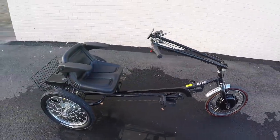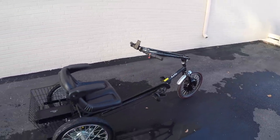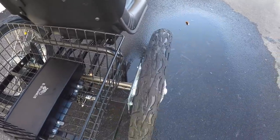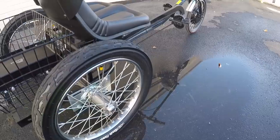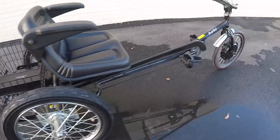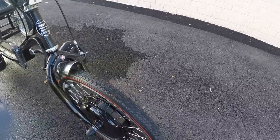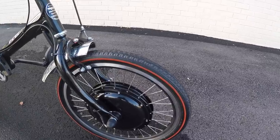They call it the Personal Activity Vehicle and it feels a little more like a vehicle because of these extras. In the back, check out these Kenda flame tires — three inches wide with flame print on the tread. These are 11-gauge spokes, some of the thickest I've ever seen on a bicycle, getting into motorcycle territory. Up front by comparison it's 20 by 1.75, much skinnier, lighter, easier to steer, with 12-gauge spokes.